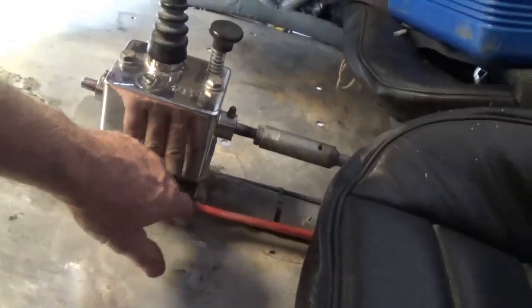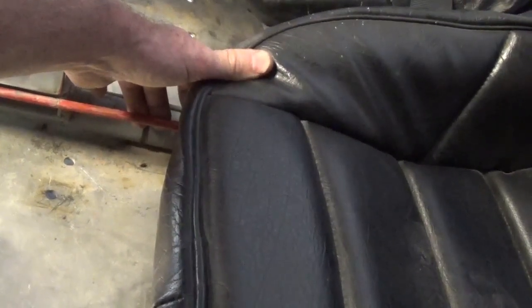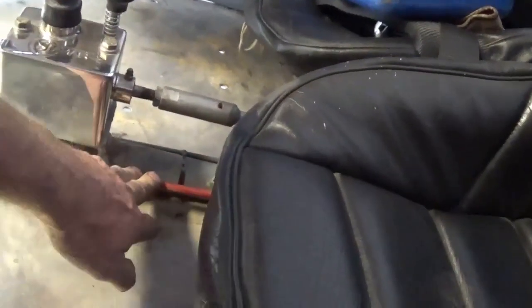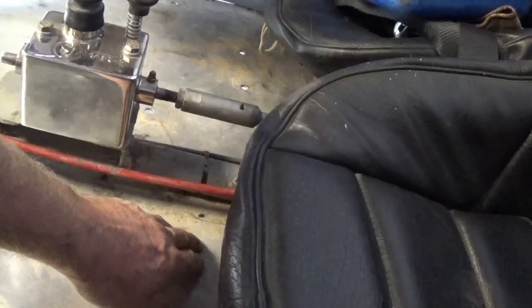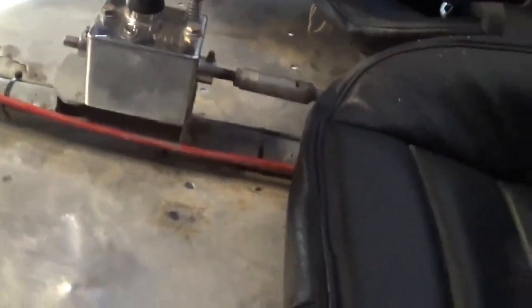That's why I like the solid wire. Another feature of doing it that way was you could put the palm of your hand on the edge of the seat, not use your foot at all, reach down with your fingers and the heel of your hand on the seat, and just pull up on the throttle to hold a constant throttle position — the whole buggy would run a lot smoother. Coming off the big sand dunes back into the staging area where it's all whooped out and choppy, I would use that to go nice and steady at slow speed.